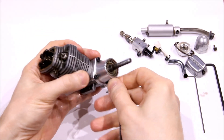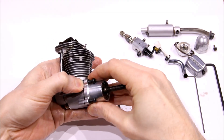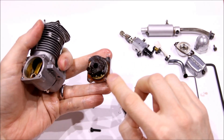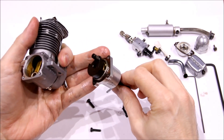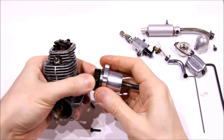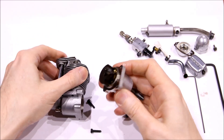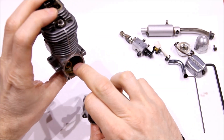Next we'll take off the front end. It just comes straight out of the crankcase — it can be a bit tight sometimes, but generally unless it's really gummy, it'll come out without a problem. The gasket is typical of Enya four-strokes and should be there. It looks a little dirty and a little rusty. The bearing looks a little odd — it's a different design I've not seen before. The bearing is protruding about halfway, and that's what lines the housing up with the crankcase.